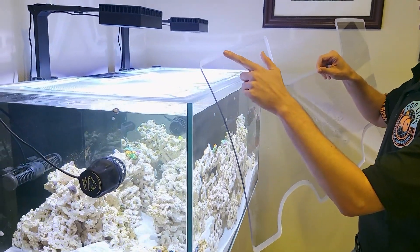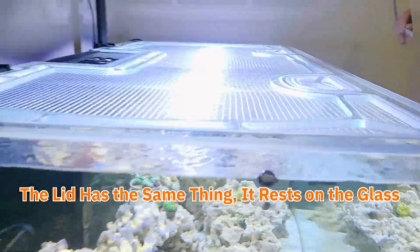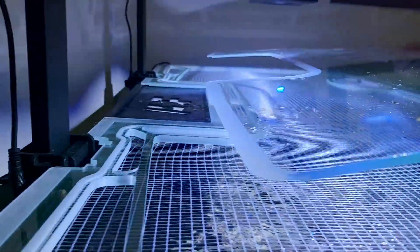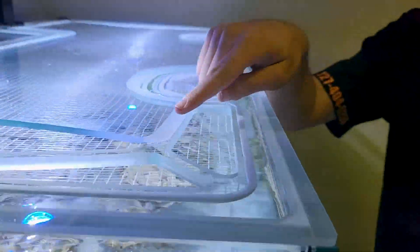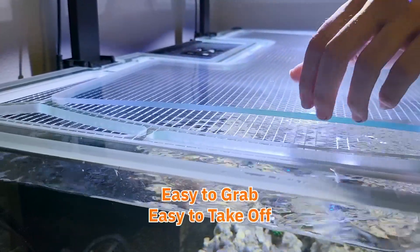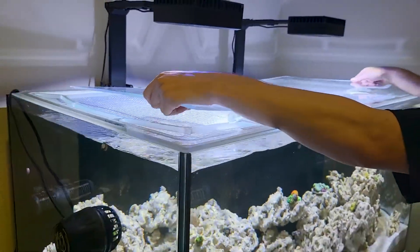I'll show you how it goes on. These tabs here — the hazed portion — are tabs that rest on the frame. If you look at the lid, it has the same thing: this is what rests on the glass. The evap cover is going to sit on the frame of the lid; it does not sit on the screen, because both sit on the frame. Come back just like that — let's see if I can get it first try. Boom. It sits on the front and also the back, so you have front and back support. On the sides we keep them open with these openings to make it easier to grab when taking it off — if it were totally sealed it'd be hard to get your finger under. So it's easy to take off and put back on, just like that.